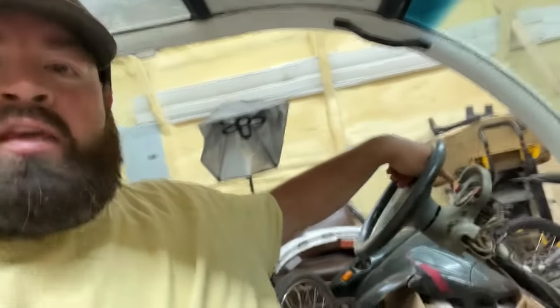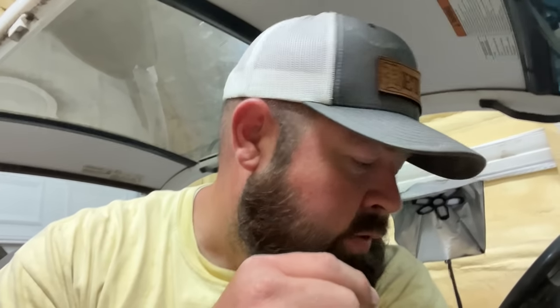I got back to the garage, went inside, uploaded files for the video, grabbed a bite to eat, and did some researching. I downloaded a fault code guide — it says that code-8 is something like a high pedal disable, something to do with the pedal. I'm thinking about taking the pedal out of the floor and going through it — maybe try to clean it up and see if we can get rid of that code. It was driving just fine and then that happens. It's always something — no big deal, something else we can work through. Let's grab it and growl.